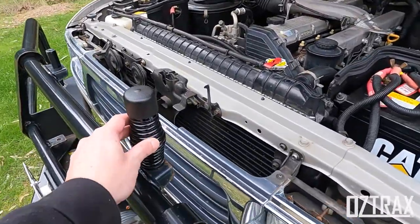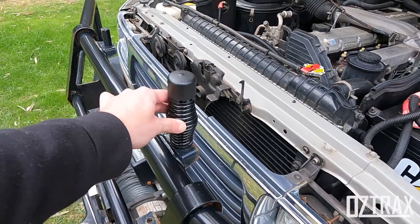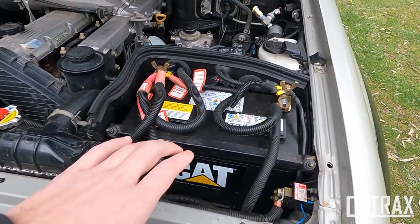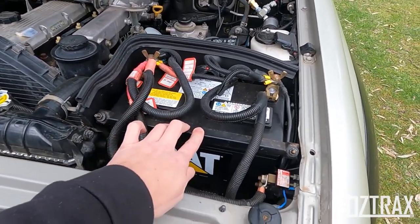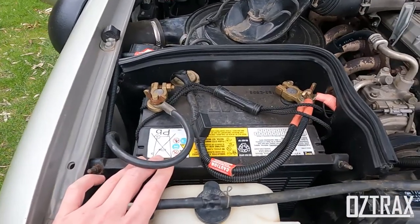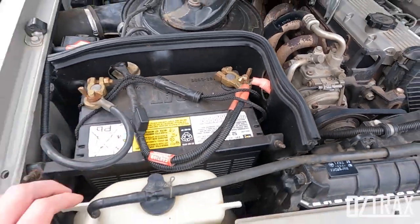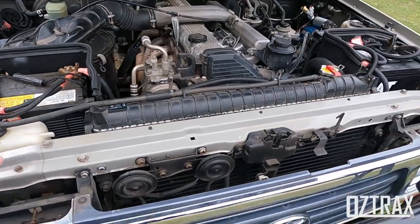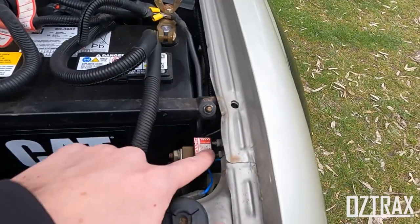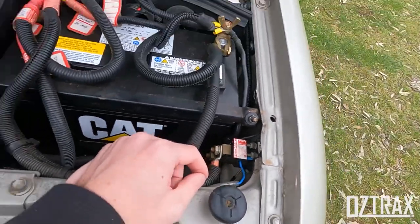I've just recently repaired my original GME mount from the 90 series — I snapped the cable off on one of my first trips, so I've had that repaired. The wiring is not mine but it will be tidied up. The winch is hooked up to a couple of CAT batteries: a big main one for starting, and an auxiliary at only 52 amp-hours, which is not a lot of capacity and will probably need to be changed out. My AGM won't fit in there, but I do have plans to get lithium. It's running a Redarc SBI 12 isolator, which was put in by the previous owner.